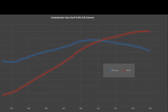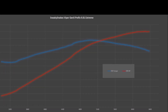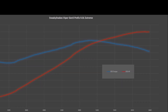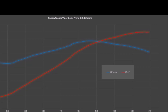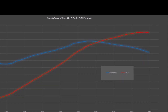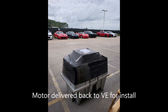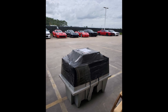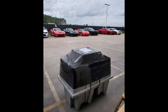Prefix told me that motors with some miles on them can dyno around 30 horsepower more, so expect around a two to three percent increase in power after the motor loosens up. Once the motor gets installed and I get some miles on it, I'll put it on the same chassis dyno I've used when the car was stock, full bolt-on, heads and cam, and now with the 9-liter - so we'll be able to overlay all four curves and see how the power curve evolves with each stage of upgrades. Join me in part five where we drop the motor into the car, do the first fire, and go for our first drive.